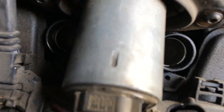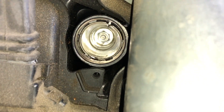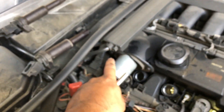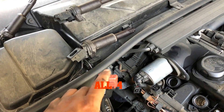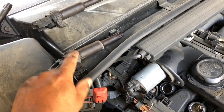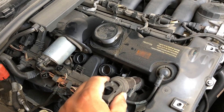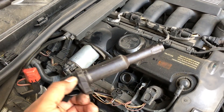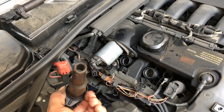I don't see any oil, so that's good. Pretty much what I'm gonna do right here is replace the spark plugs on these cylinders. Before replacing the spark plug, I'm gonna take this coil I removed and instead of putting it back where it was, I'm gonna put it on this other cylinder to see if the misfire transfers — that gives me a better idea if it's the coil misfiring or the spark plug with a bad connection.